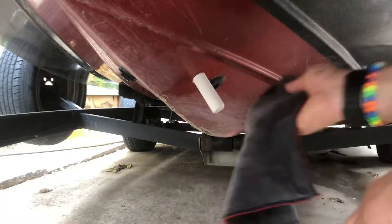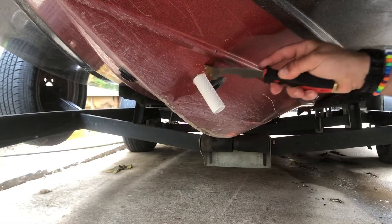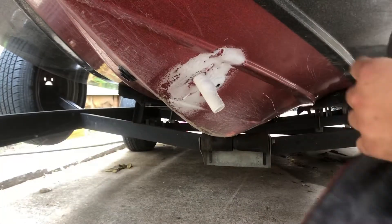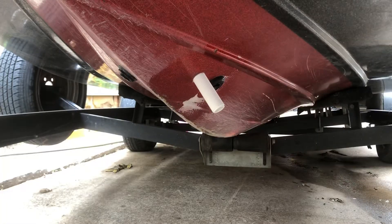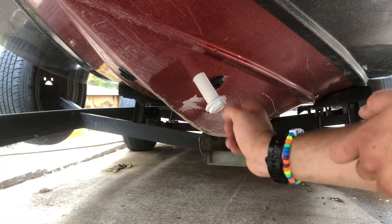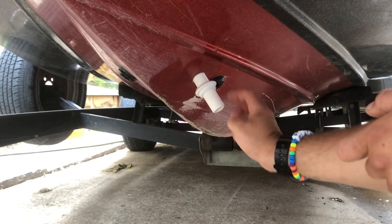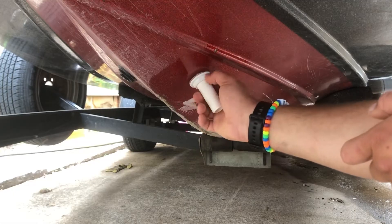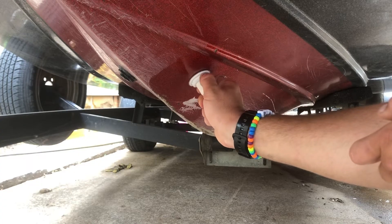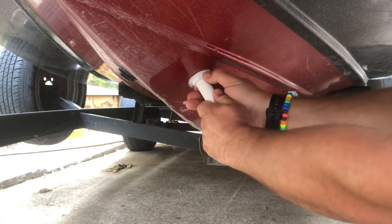It's really important to get a nice clean surface. I realized doing this that Goo Gone is absolute crap — it didn't remove the residue from the previous silicone very well. I'd highly recommend using acetone, and then once you're done, do a little glass cleaner to degrease the area and give you a nice clean surface. Then spin the nut onto the thread and get it nice and tight. Once it's pretty much tight by hand, try to get it as tight as possible with your hands.